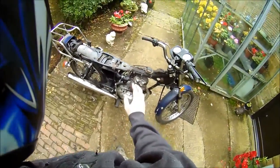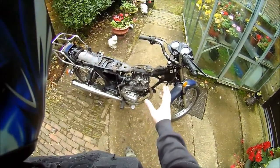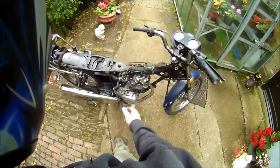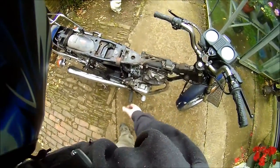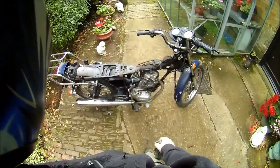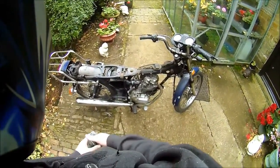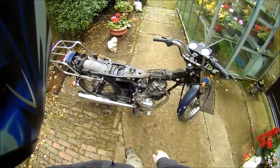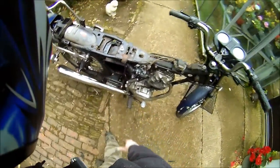Engine — the head, the casings, everything is coming off, stripped clean, serviced, painted. The carb's got to come off and get cleaned anyway, so that will get a good service. I'm thinking the carb might give me some trouble. I've weighed up the issues between finding side panels and getting the engine running happy with a pod filter, and decided that the airbox is coming out and a pod filter is going on after the MOT. That leaves it exposed — don't have to worry about the side panel. I do have one, but it looks hideous.